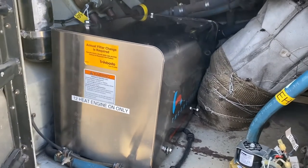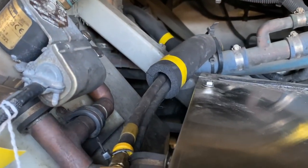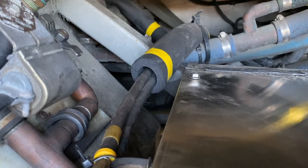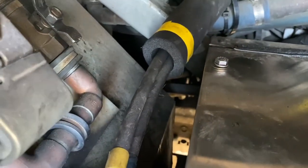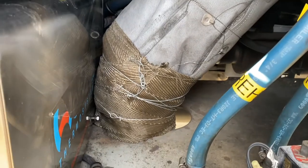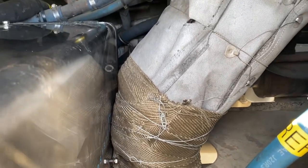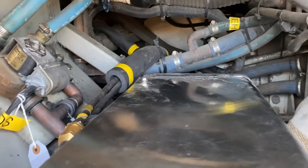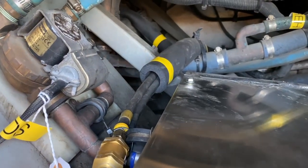The system is buttoned up now — just tightening up some screws. Something else I did over the summer is I replaced these two fuel lines that come from the tank. That was a pretty hard job the way Marathon snaked those lines, but I'm using mil-spec diesel fuel lines. The reason it happened is the second owner of this bus broke the exhaust flange and drove down the road, releasing all the heat into this compartment, making a lot of stuff very brittle. The fuel lines were very brittle and cracking. At 20 years of age, it's probably something to be thinking about.